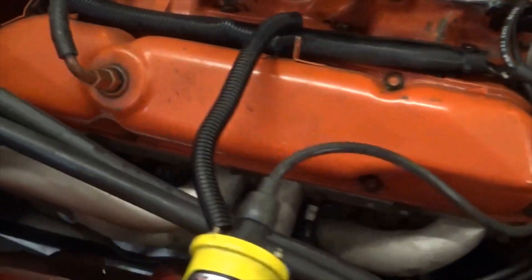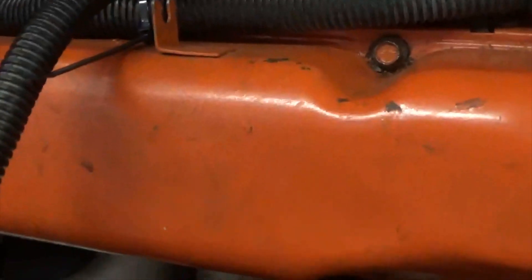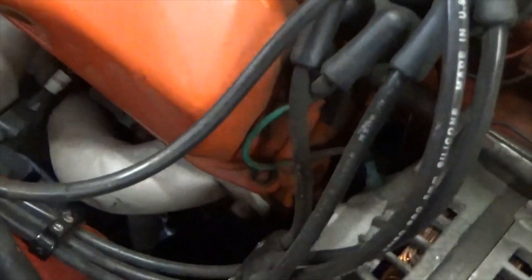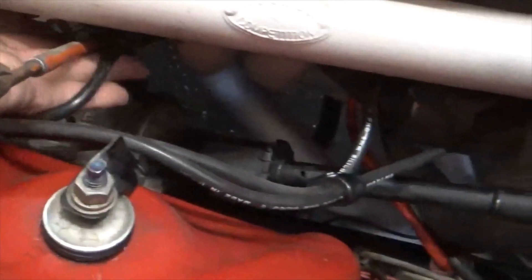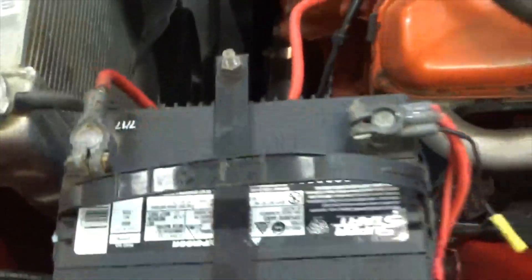All the plugs are in and all the plug wires are on. Now take a moment to go back and make sure all your spark plug wires are routed away from the header tubes so they don't cook. That one's close — see how that is? That's the only way it could go in; without a 135-degree boot it would not work. A 90-degree boot coming straight up would route the wire over the top of the header and could cause damage. Make sure everything's free and clear on both sides, no interference between wires and header tubes. Reconnect the battery and we're good to go.